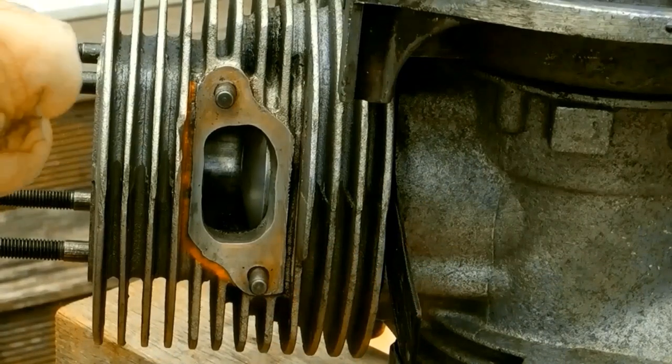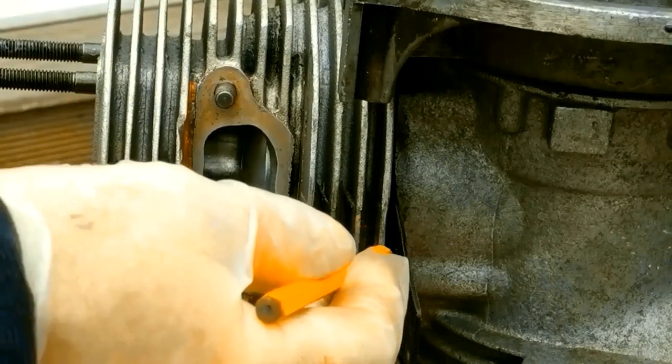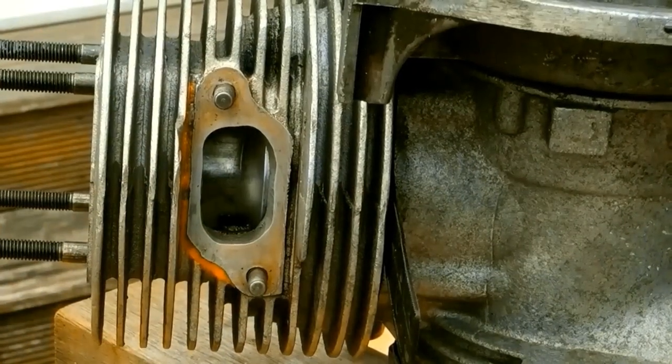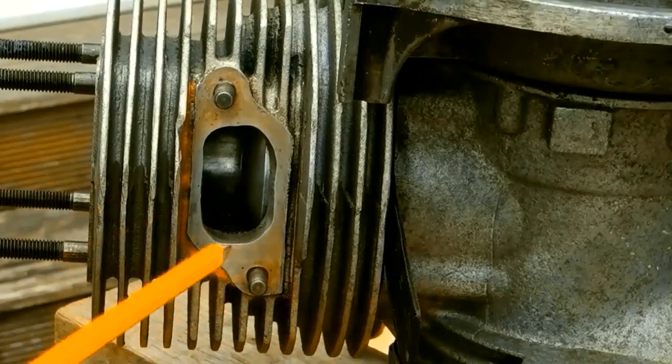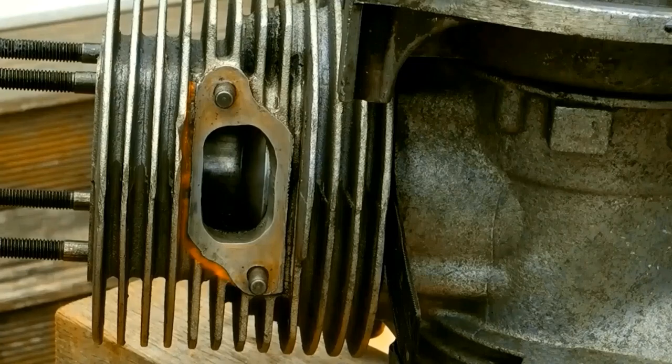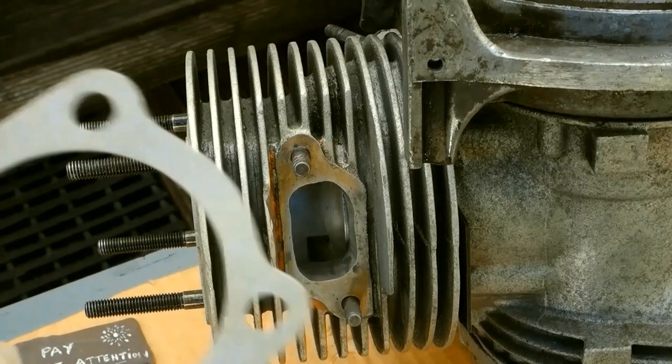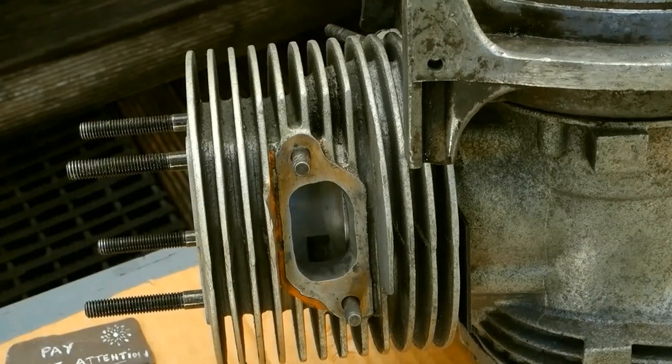Previously the squish was practically non-existent, so by putting the 2mm packer in, I improved the port opening and the squish. Since then I'm retaking the squish, and with a 2mm packer, the squish is 1.85 on average. According to Sticky's, ideal squish is between 1.2 and 1.5. So the options I have now are to bin the 0.5 head gasket, go with a 2mm packer and 1.85 squish, or size down to a 1.5mm packer to improve the squish.